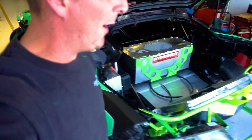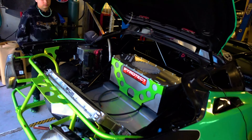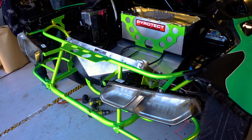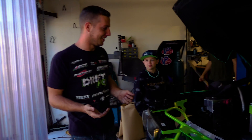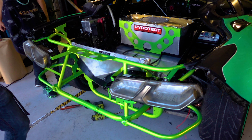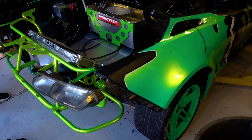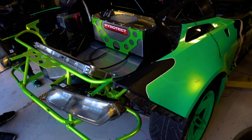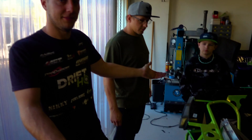So we just got back from powder coat and we are reassembling the rear end of this beautiful masterpiece. I'm so excited — I love it. The color of the green here almost matches the monster in the livery colors pretty well, so I'm pretty happy about that. We got all of our holes and stuff drilled out because the powder coat builds up in some of the little thresholds and areas, so we had to clearance a few things and got everything fitted back up.